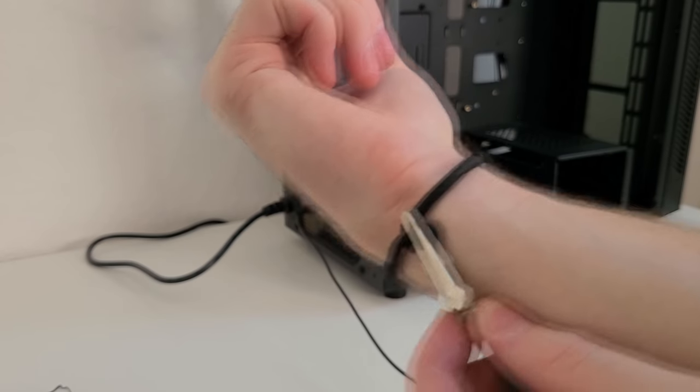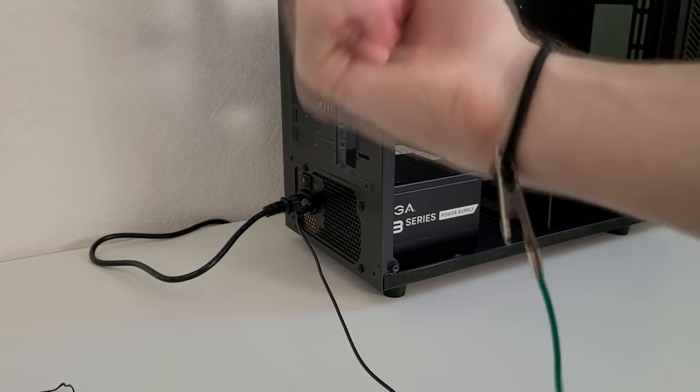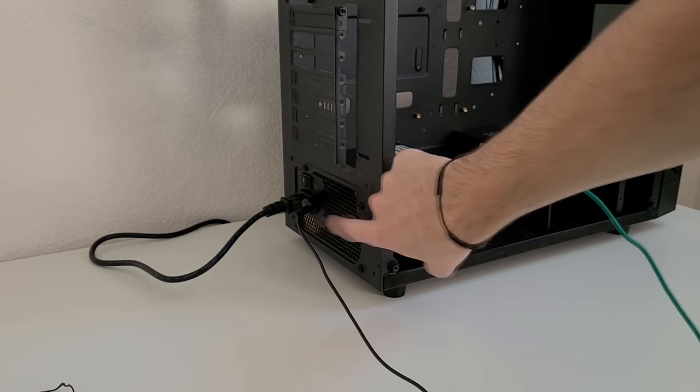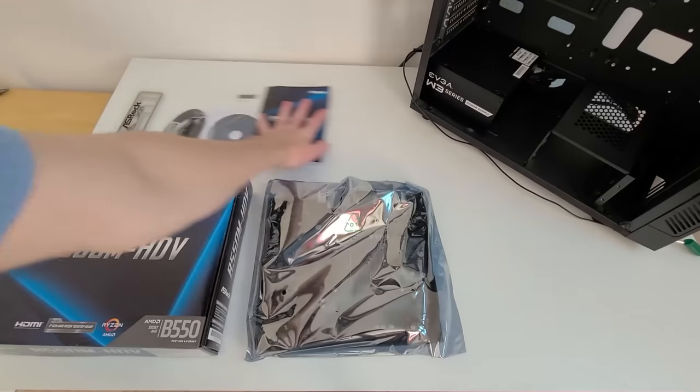The one I'm using is homemade, it works perfectly fine, but I do recommend you grab one from Amazon. I'll have a link to one in the description. But to ensure that the anti-static wristband is working properly, attach the clip to the metal part of the power supply. Now what's the point of this? If you accidentally shock your motherboard with static discharge, you may break your motherboard. The wristband eliminates the static discharge. Not required, but I do highly recommend it.